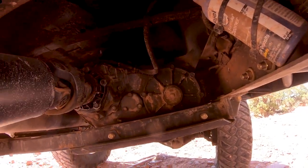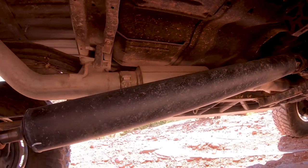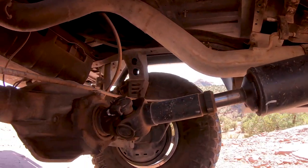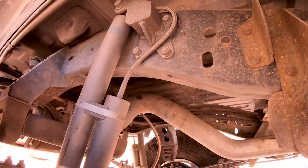It's got a Magnum transfer case from Off-Road Design. That combined with the 488s and 2.5:1 first gear and a 4L80 gets you, I think this should be like 65:1. And you can run around in 205 high and low and then shift into your Magnum. It's a great way to have a multi-speed transfer case.